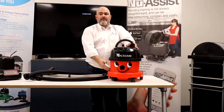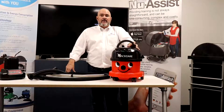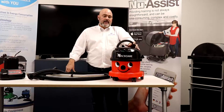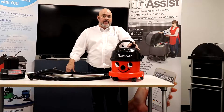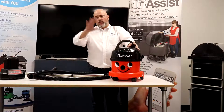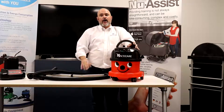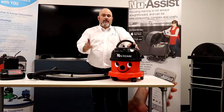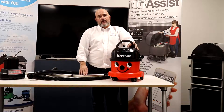...is that they are color coded. Red is Henry's color. He does not like to be used as a wet-dry vac. The motor doesn't like water — it's a dry vac only. If you're going to do water, that's a totally different training discussion on a different piece of equipment. Don't suck up water with Henry, because that's your first problem — you'll cook the motor, because he doesn't like water in his motor.